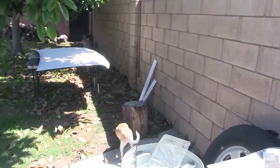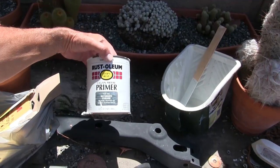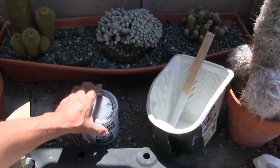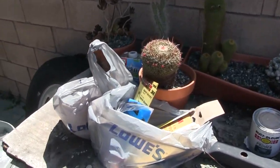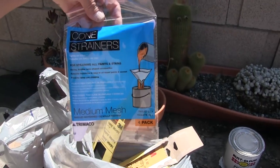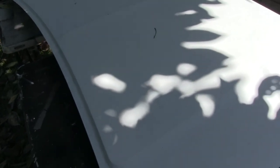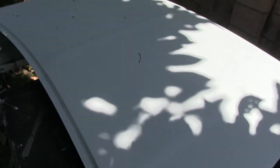I'm not buying any expensive primers because I don't want to waste my money - what do I know, right? The most expensive thing was the paint to match the truck. For primer I'm just using some Rust-Oleum clean metal primer. The issue is this can is kind of old because there are all kinds of little chunks in it. I shook it, I stirred it, and it still had them. I learned that there's a strainer you can buy to strain that stuff out. I did this section right here in the shade.